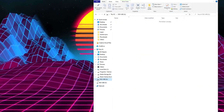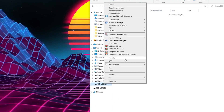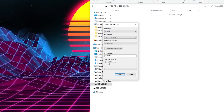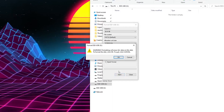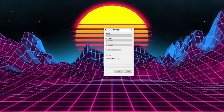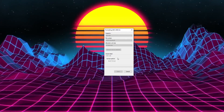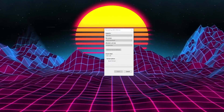To reiterate, you are going to want a USB and you're going to need a computer to download that BIOS update to put it on. When you do, you're going to want to make sure it's formatted correctly in FAT32. I would definitely go ahead and make sure you do the full format — don't do the quick format, do the full one. Make sure it erases everything. The BIOS isn't something you want to play around with.